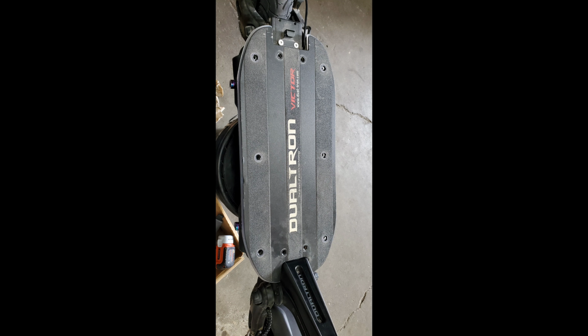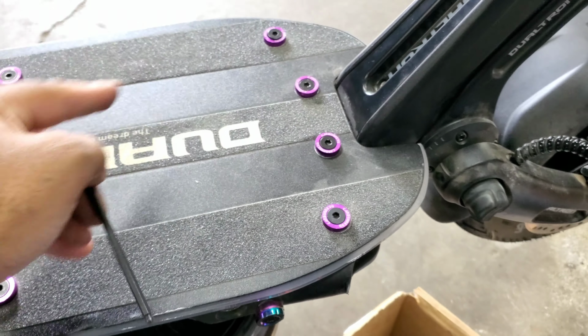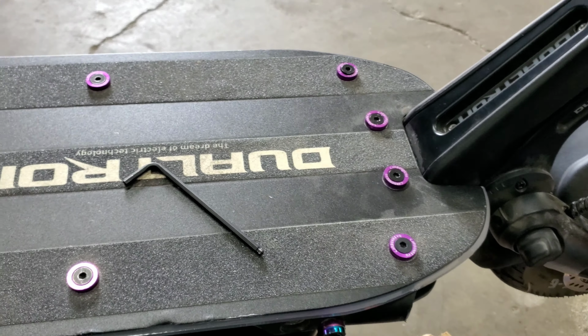These guys, in order to get these guys back in, you have to compress the board. You have to push down on the board. You have to push down on this area while trying to screw it in, and then you'll get it to tighten. So if you guys need to, it's a number 5 hex key. You may need to go to the parts store and buy a slightly longer bolt. It could be just whatever the next length is. I don't know what length these are, but whatever's the next length from these, you can go on ahead and get it. In fact, go to the parts store, take one of these bolts with you, make sure whichever one you're gonna replace it with actually screws in. Make sure this one screws into the same threading that the one you're gonna buy screws into. And just get a very slightly longer one than this and you'll be good to go.